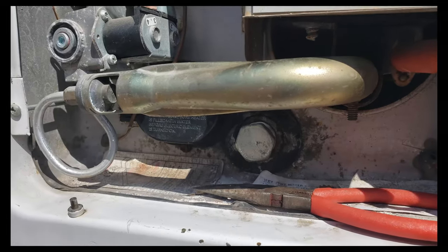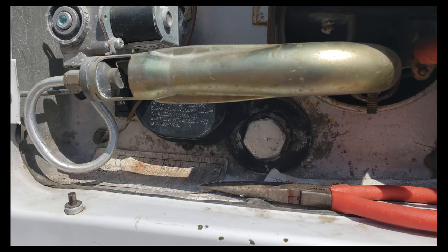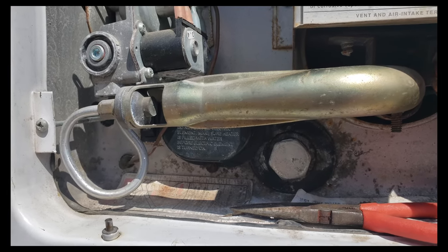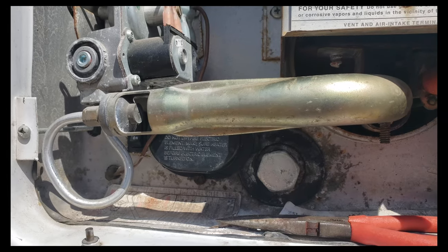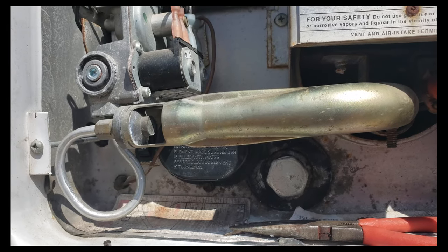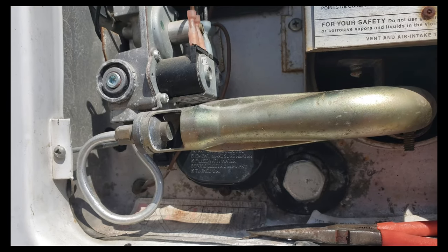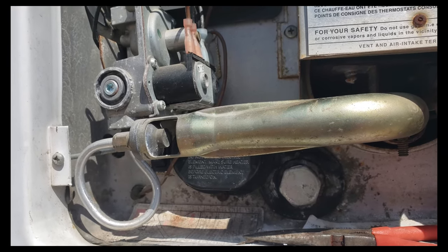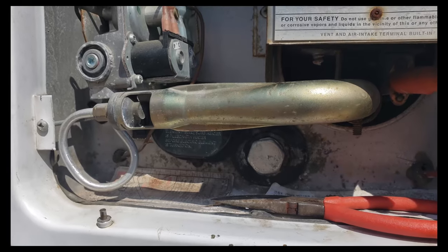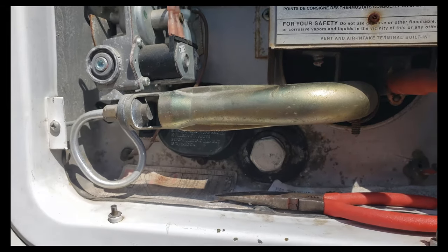It can be a little awkward in tight spaces, like everything RV — everything's tight. But with the proper tools, which is just a screwdriver for prying out the old switch, and then I took some needle nose pliers and pulled the leads as far out as I could to facilitate placing a new switch in without tying yourself in knots. Then you just push the new switch back in and reattach your gas feed tube to the gas portion. And that's it — really that simple. Good luck with your projects, and thanks for watching.